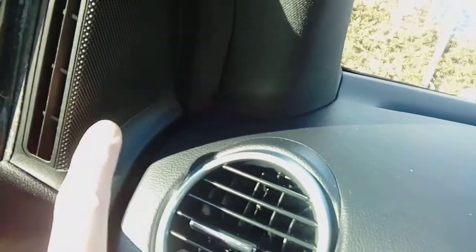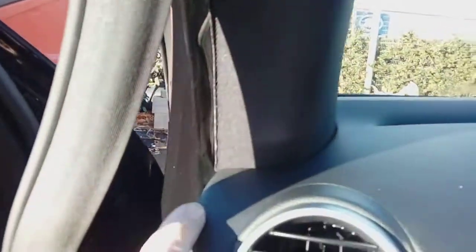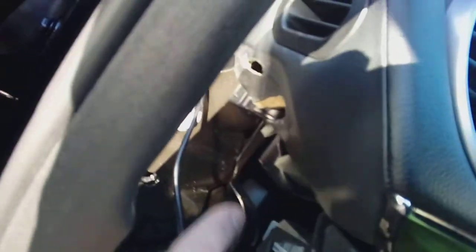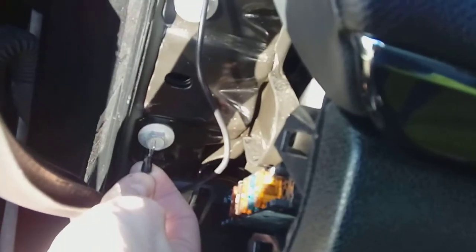Run your cable down under the edge of the trim all the way down to the bottom, to the side plate on the end of the dashboard. When you get to the bottom you're at the position of the front fuse box — but as mentioned, this fuse box is completely useless for this job. Instead, we're going to remove a 13mm bolt from the dashboard as an earthing point, put a ring connector on the end of the black earth cable, and secure it underneath the bolt head for a good earth.